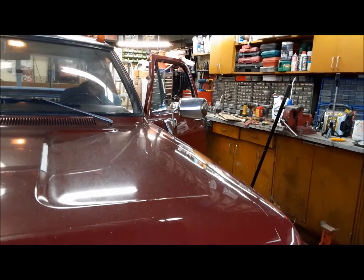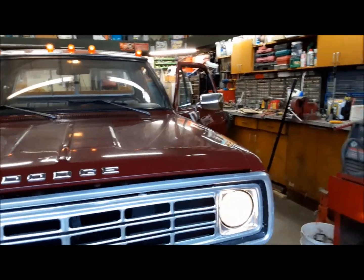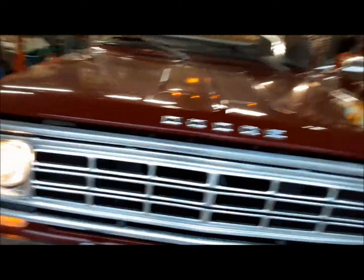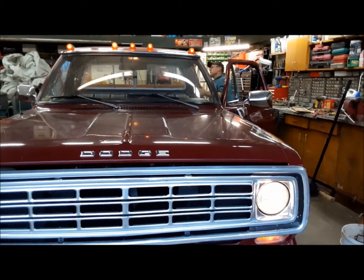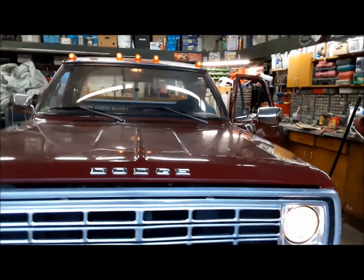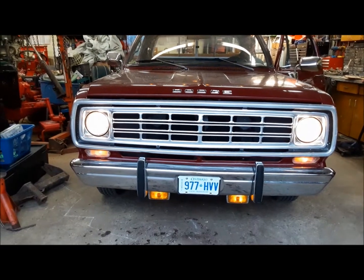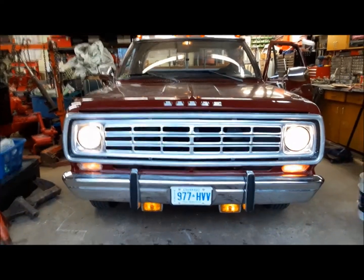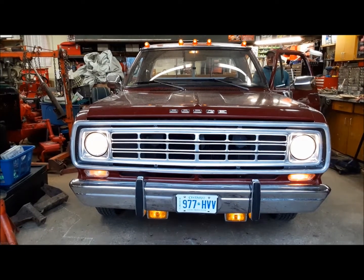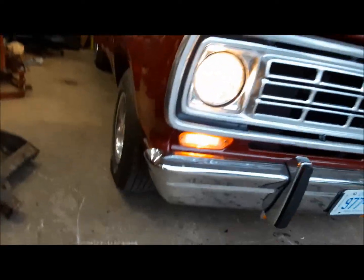First, we're going to check the lights. Deb says the front lights work — let me go check the back. Upper and two license plate lights — that's good. Oh, it's got a cargo light. There we go, cargo light works. Your cargo light doesn't have to work to pass safety, but it's there so I want to check it. High beams — good. Left turn — and it works back here. Right turn — make sure the one on the side of the fender is flashing too. That's good.